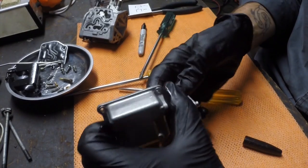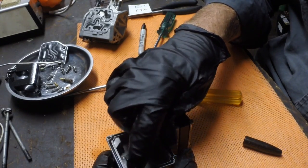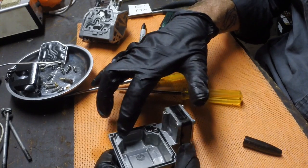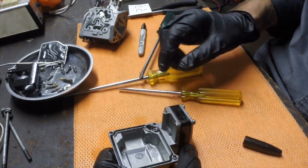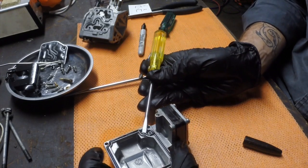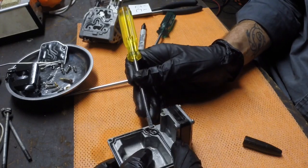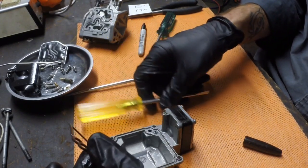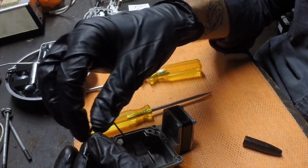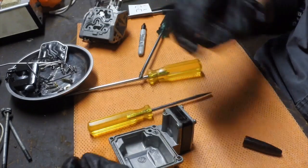But in this case, the bowl itself is pretty good. Another point I should make, I think I mentioned it earlier, these gaskets are designed to be in fuel. They're a bit fuel resistant, but ideally you shouldn't be getting carburetor cleaner on that like that. Sorry about that. These will just lift out. It is just seated in. So try not to get carburetor cleaner on anything not metal. So, my bad.